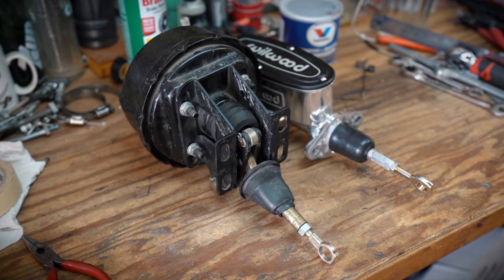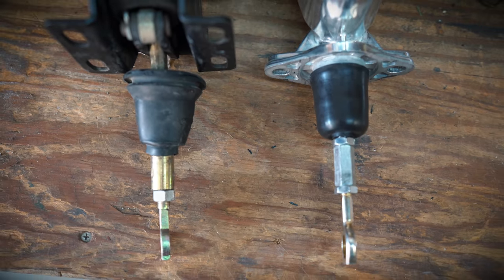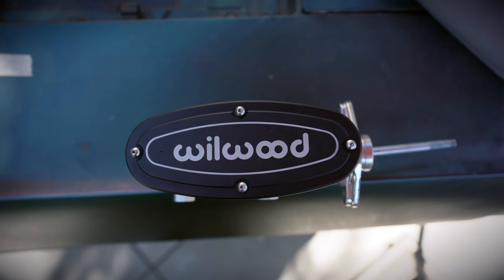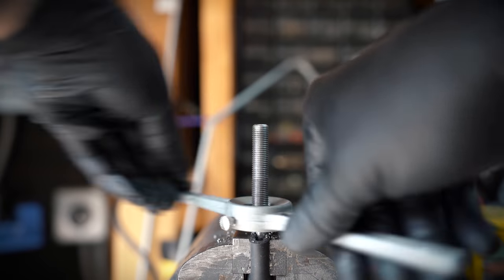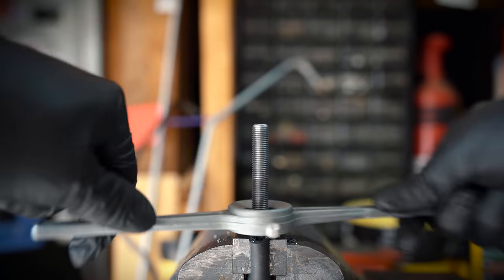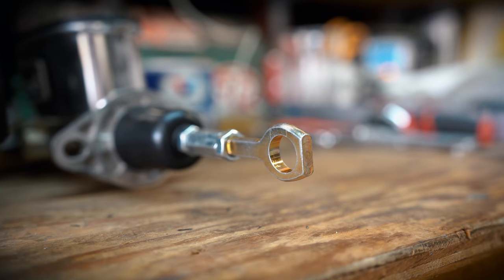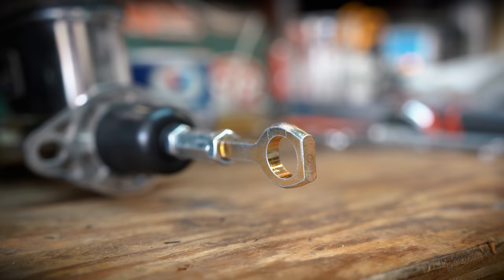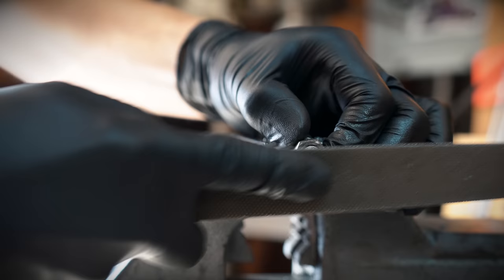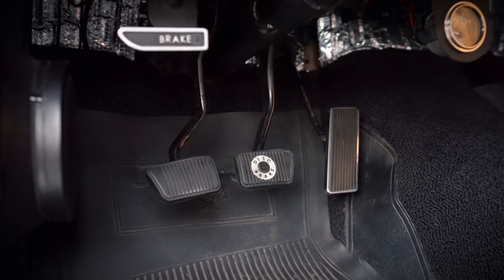After I took the old booster out, I matched the new master cylinder's push rod with the old booster, but I had to make it a little longer due to adding the plate to the firewall. I used a tap and die set — specifically the die — to add extra threads to one of the push rods. My process was to make a small adjustment, install it in the car, attach it to the brake pedal, check the length, then trim it down. It took several iterations — each adjustment made the pedal too high or too low — but I eventually got a good length.